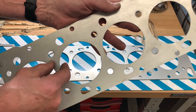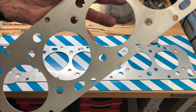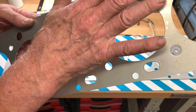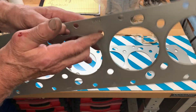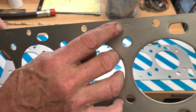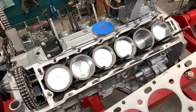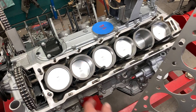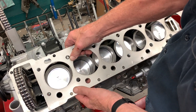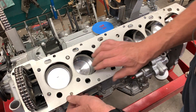These aren't bad. This stuff right on the firing ring — you don't want to scratch at it too much; I don't want to damage that sealing surface. So anyway, this looks like a pretty good gasket. Another thing you want to look for: it says 'top' right here. This means it needs to go out toward you when you put the gasket on. And remember, there is an A side and a B side — this is the B side. You may have to flex the studs around a little bit in order to get the gaskets to go on.